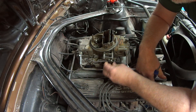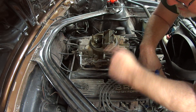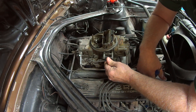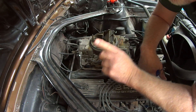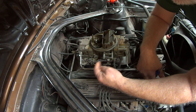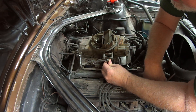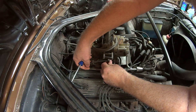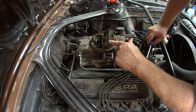Then with a hot motor, I just start closing the choke and it'll run faster and faster as the throttle opens. But eventually the motor will be too rich and it'll start to slow down. What I do is as it gets faster and faster, I set it till it slows down about 50 RPM. Then I take the cable casing and just push it through — I don't want the choke to move. I got to open this screw up a little bit more so that it holds the choke in that position, so you can't pull it past that 50 RPM drop.